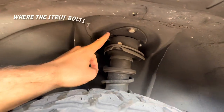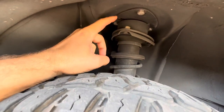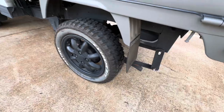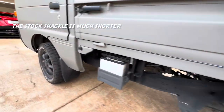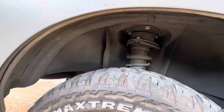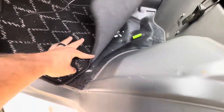You're also going to want to check where the springs attach to the body. This is your strut with a coil spring — in this case it has what looks like a two-inch lift with a camber plate on it. In the rear it's leaf spring with a spring shackle. Most of the time the strut spacer won't be there. Make sure there's no rust right around the top — you can inspect the inner side here and check all the way along that area.